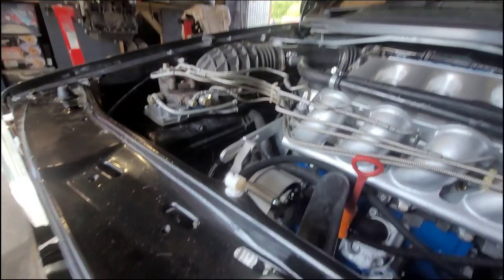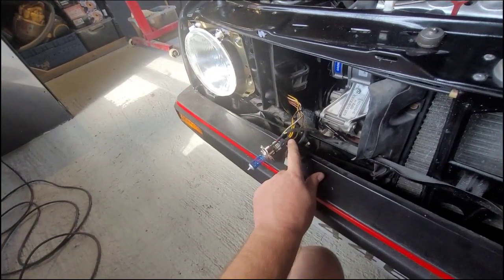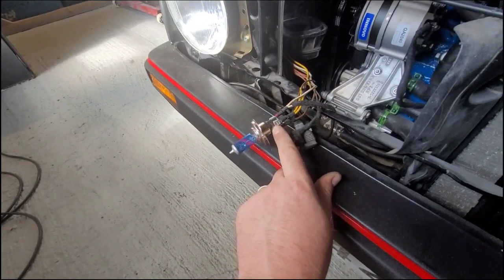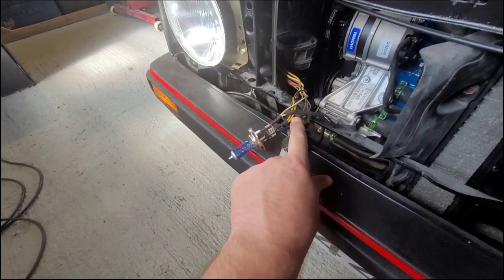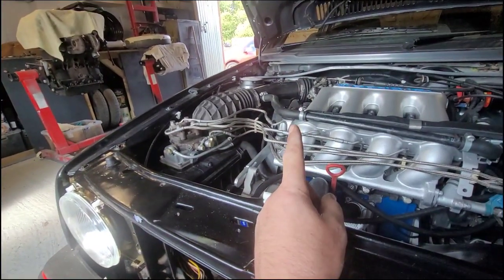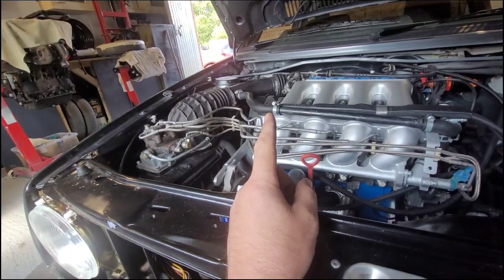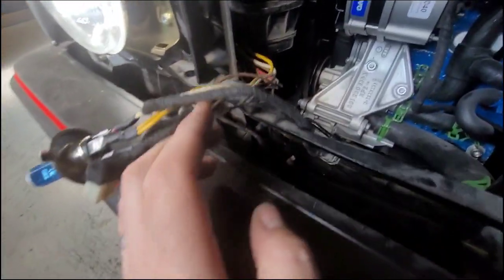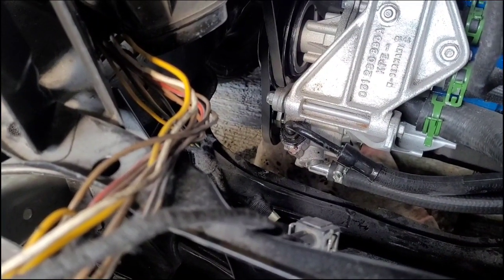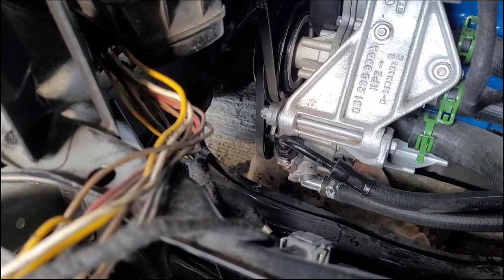Next thing is to sort out the wiring loom. I've got to chase the power feed to the actual fuse box, because I've got power at those connectors, but as soon as I connect them to the bulb, no power, which means there's something wrong with the wiring, it isn't letting the current pass through. So I've got to check the fuse box end and double check that's connected there. Then there's the headlight. And we've got a leaky power steering pump just down there, the union's leaking on it. So I need to get down there, clean it off, tighten it up, possibly take it out and change the seal on the end of it.